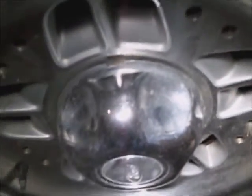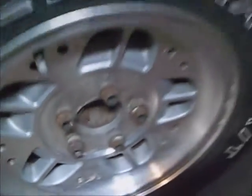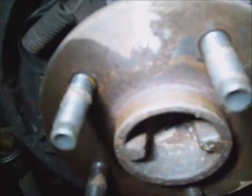I'll need to take the rear wheels off of it. Take a screwdriver and catch that slot and pop that center cap off. Remove the 19mm lug nuts and take the wheel off both sides. With the wheels off, I went ahead and took the drums off. Spray some penetrating oil around the center axle flange and just keep hammering on the drum in a circle until it dislodges.